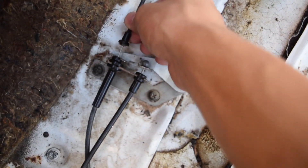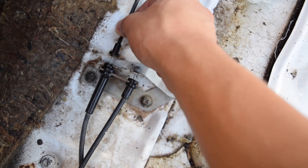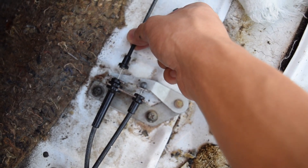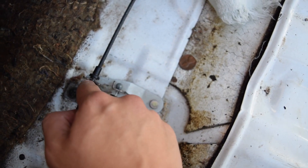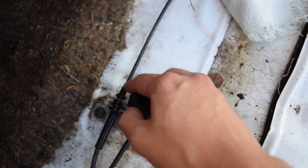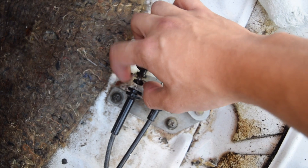On mine, this little plastic piece right here broke — this little tab separated from the inside. So now when this tries to pull to pop the gas latch it doesn't do anything. I went ahead and made this little piece; it just slips right over the end here. You can cut off the old piece, but it actually works with it still on. It just slips over and holds this piece to that, so whenever this gets pulled all the way it all pulls back at once.